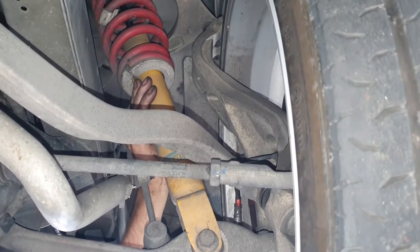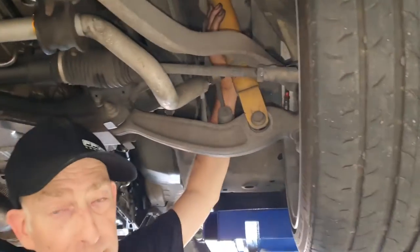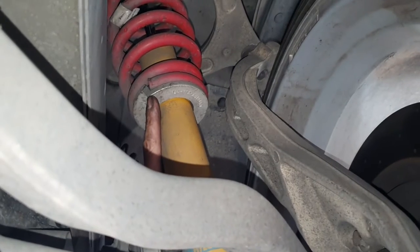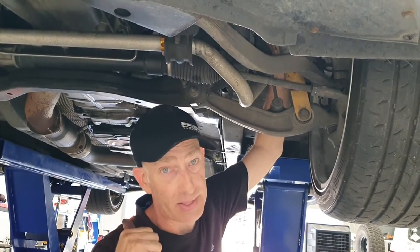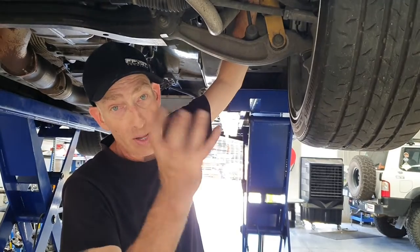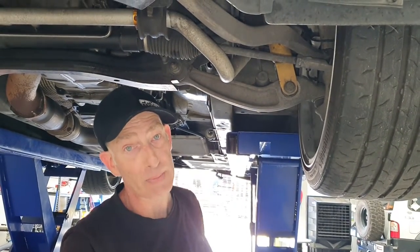As you can see on the front, I don't run an actual fully-adjustable coilover. The coilovers on my car have just got three platforms — they're a different design on the rear. These are the Bilstein struts. This little plate is adjustable; if you were to uncompress the spring, there's a little circlip on the bottom that you can raise that platform up and down. But if you had a coilover on the front, it would be exactly the same as the rear — two little windy spring platform things. You'd back off the bottom ring, wind the top ring up and down until you had your desired suspension height, and job done.